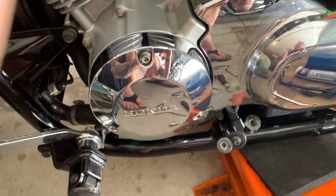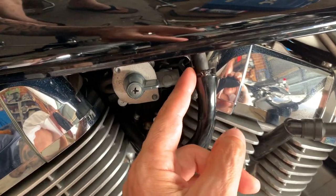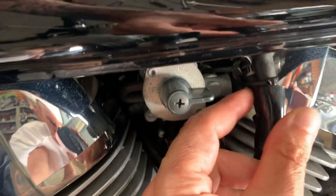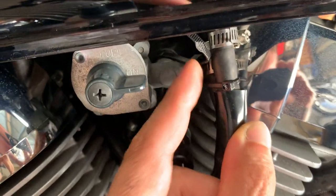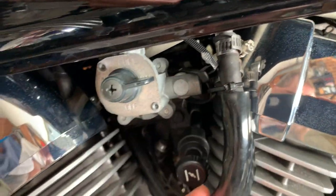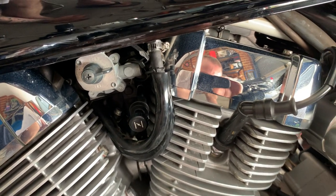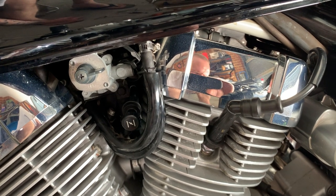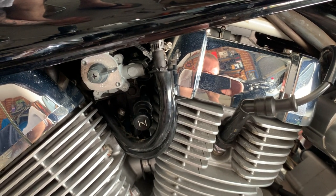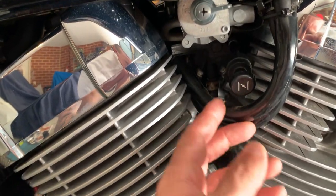While we're on this side of the bike, I'll also show you where I've zip-tied these hoses out of the way. I put hose clamps — you can't see them probably under the cover, but there they are at the top. Both these hoses run into the carburetor from the radiator to warm the carb up. If you're ever in cold freezing climates you might need it, but we don't need it here, so I've bypassed all that around your choke.